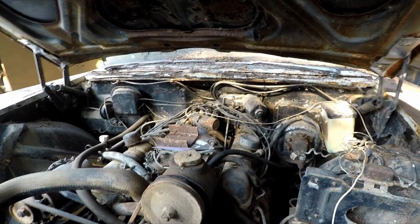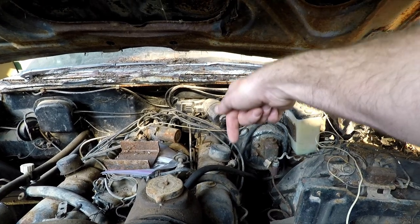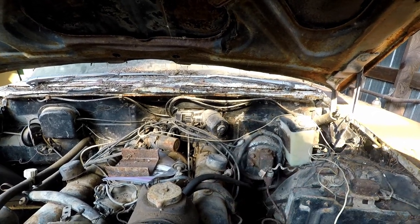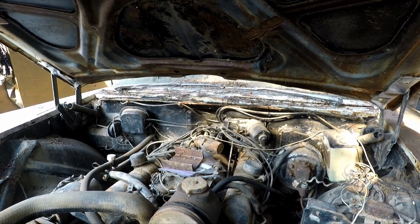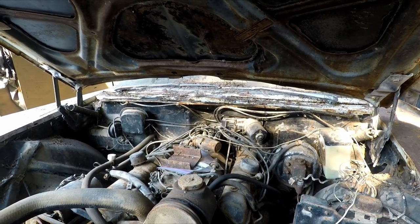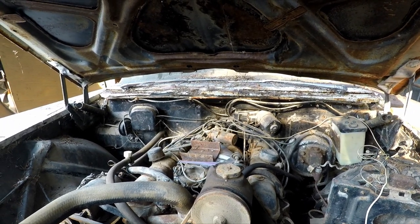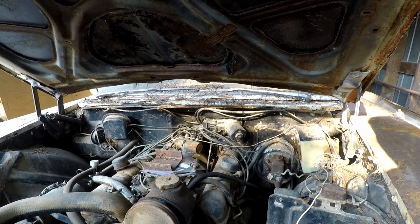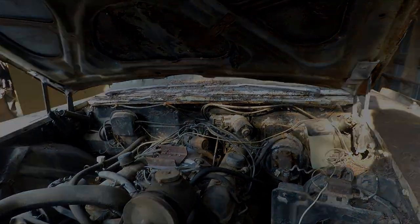This is a nail head. You can see the valve covers, they're sort of like straight up and down. The valves are going basically straight up and down. They're not on an angle. Any other engine with valve train that is at an angle, like small block Chevy is 23 degree, LS stuff is 15 degree, etc. I don't know what the degrees here on the old nail head are, but they are basically straight up and down. That's why they call it a nail head. Now, I'm not an expert, but that's what you can see by looking at it.